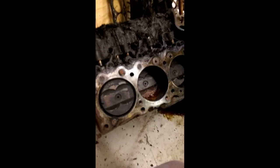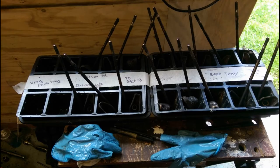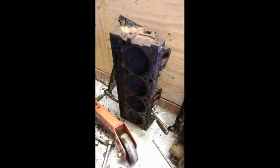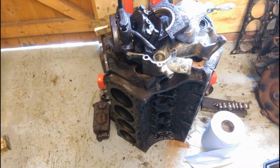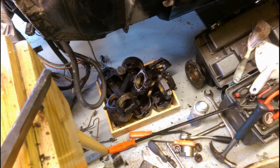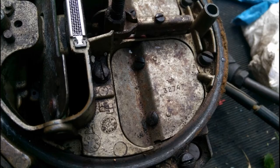I'd stripped the engine down at this point and bought myself a fairly cheap parts cleaner. I started labelling the pieces, separating out the heads, and putting stuff in bags. The pistons were replaced with Keith Black pistons. The cam was knackered but the crank was serviceable. All the bits went to the machine shop — the heads, caps, crank, and plate. I paid to have the block sonic cleaned and crack tested, and it was re-bored. There's also the dreaded Rochester carburettor, which was a disappointing pain.